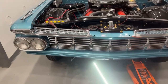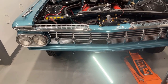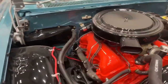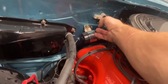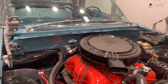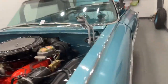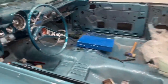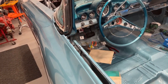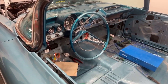I was under the car. I took the green wire off of the starter solenoid and it was on the R, which is right. So the purple wire is on the S terminal, which is correct. The green wire — I don't know if I necessarily need it, but I hooked it back up because that ties in with this white resistor wire here in the coil. Basically, I have that purple wire somewhere under that dashboard. That purple wire is cut because one side needs to go to one side of the neutral safety switch and the other side to the other. So I'm going back under the dashboard to root around and try to trace that purple wire and see where they cut it. I don't know why they would have cut it, but somebody did something with it.